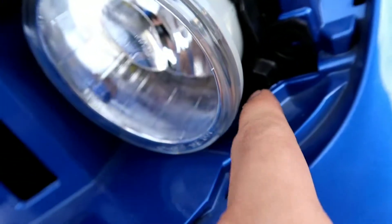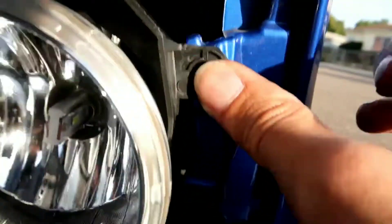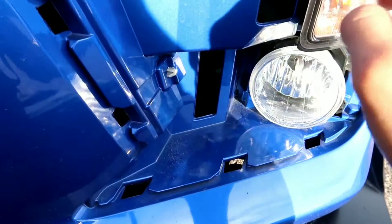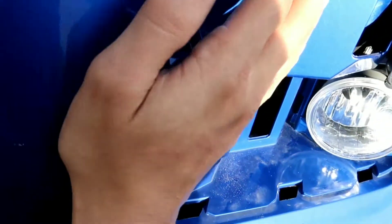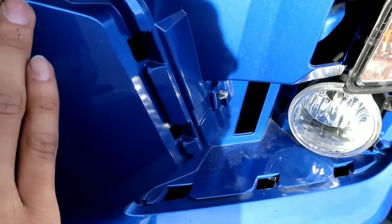What you're gonna do is push down this little part to the housing on the bottom of the bumper, and then you'll be able to position these holes and see what's perfect and then just tighten them down. When you're putting on this cover you're gonna have to push this side mainly first, make sure all the tabs are very close to where they're all gonna go. Then you're gonna be pushing this side of the housing really strong and try to get that to pop in first. Then you want to do the outside — while holding the inside first, then you're gonna finish popping in all the tabs all around. Make sure to push the two corners last.